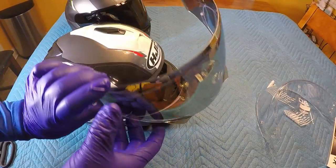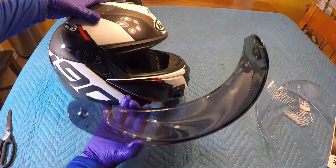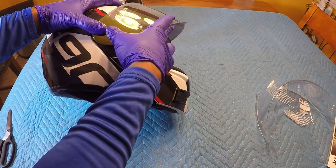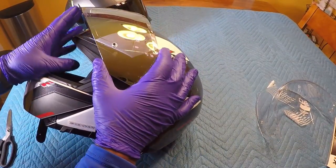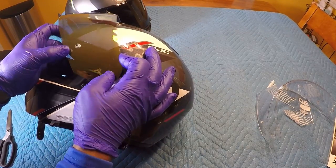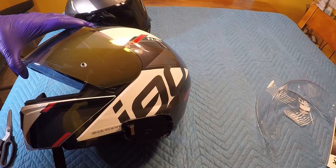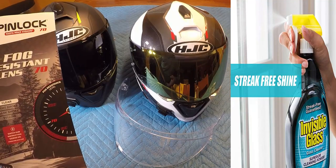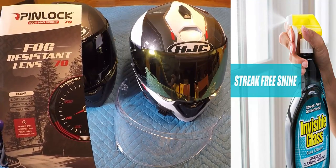Now I can reinstall the face shield, lining up that tab with the tab on the helmet at its highest position. Snap it in, bringing it around to the highest position. Snapping that helmet into place. This is going to conclude the video of me installing the fog resistant Pinlock shield for the HJC I-90 helmet,